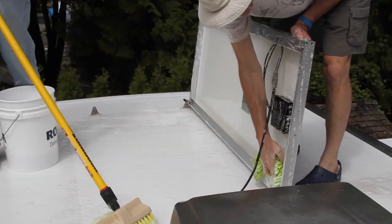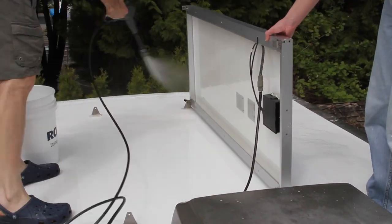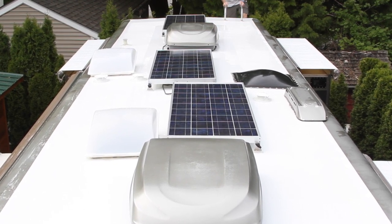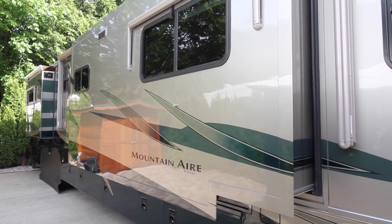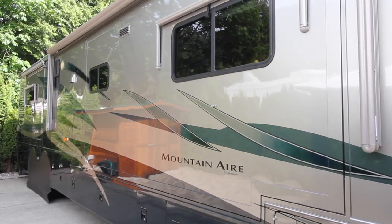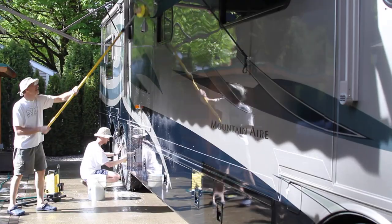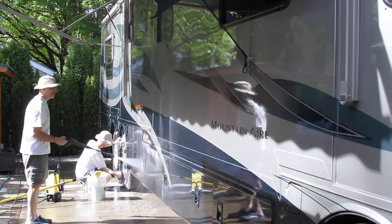Fiberglass is impervious to just about everything, but if you have a rubber roof, don't use full pressure to avoid damaging the rubber. If your roof isn't immaculately clean, there's not much point in washing anything else, since any dirt on the roof will just run down onto the sides of the RV. We find it easiest to wash the rig with the slides in and wash the sides of the slides separately — it makes the job go faster and saves a lot of headbanging. Washing in the shade is best, but you can make your own shade sometimes. Using the power washer to wash the RV saves a ton of water compared to just using a regular hose nozzle.